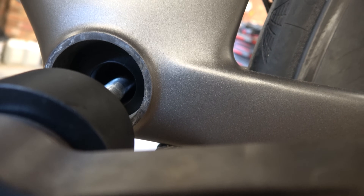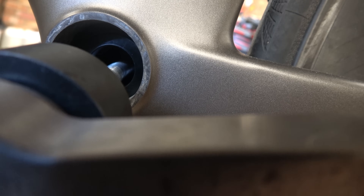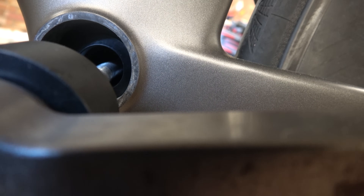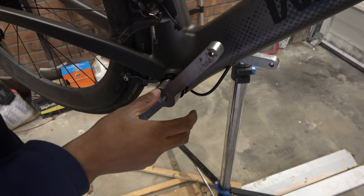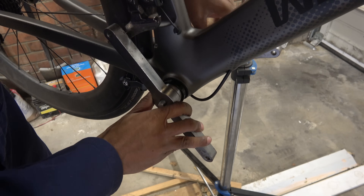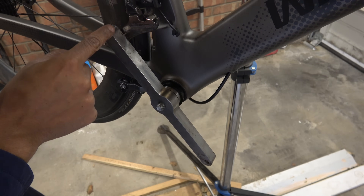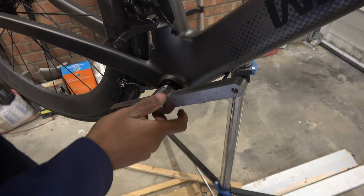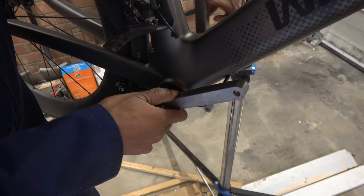What I've done is slackened the bottom bracket off on the non-drive side just to make sure you haven't got any cables that you may pinch. You can also decide at this stage whether to put retaining compound in — I'm choosing not to. Just giving it a couple more turns to get it going, and then we just carry on pushing. Just be careful because this is about to hit my front derailleur, so if we turn it up to that position we won't get that issue, and then tie in on the other side.